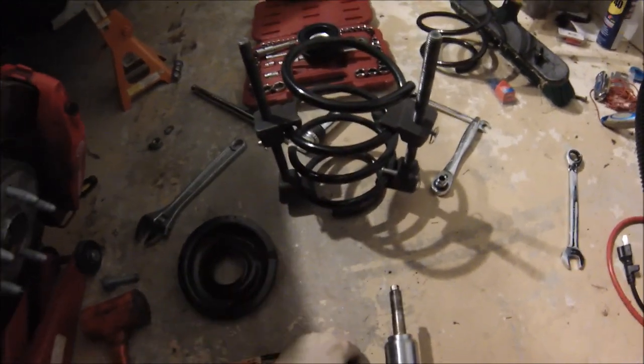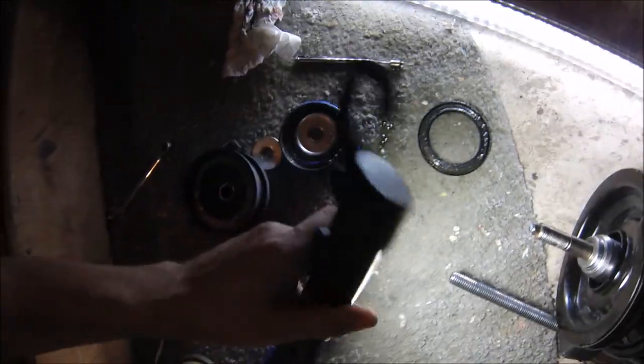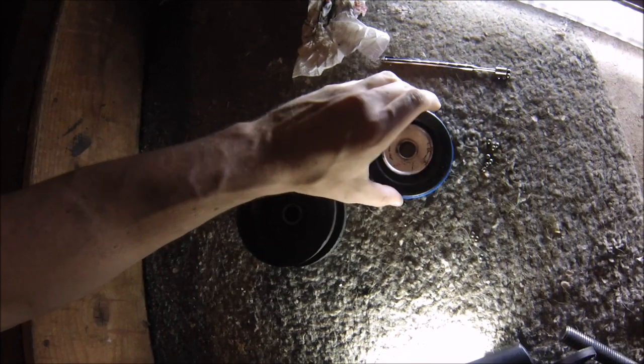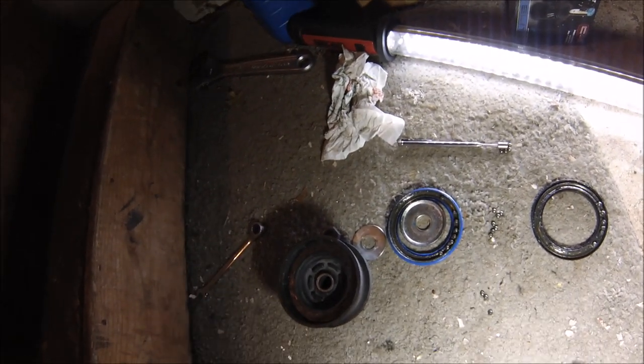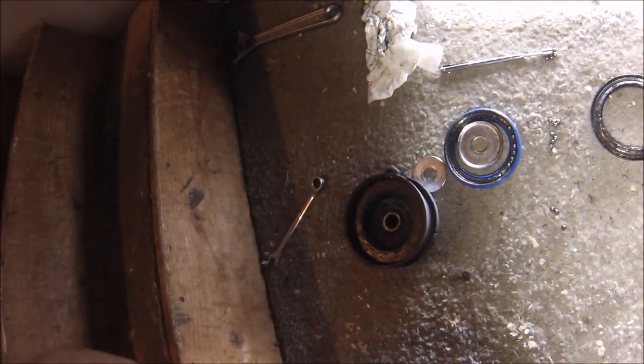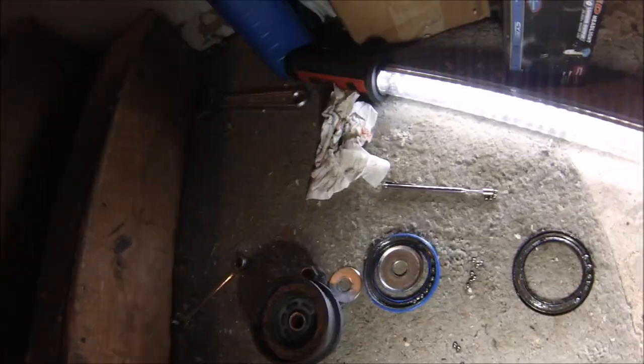So now we got the spring off. We will compress the other spring, slide that on, and reassemble. I do want to share something — this is about the third time I've taken this apart. There's a little bearing cap in the top of the shock with little ball bearings that roll around in there. If that comes apart, the bearings fall out and you've got to go put them back in. I've taken this apart twice because the bearings keep falling out when I push down. So be very, very careful with this — make sure you don't lose any of these bearings and get them clean after you put them back in.